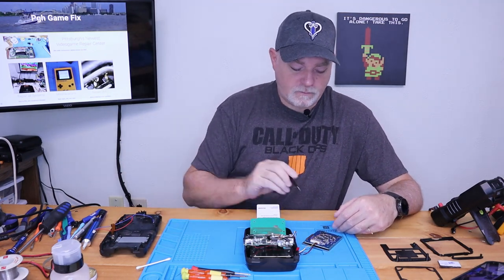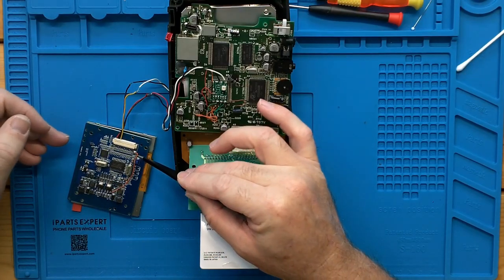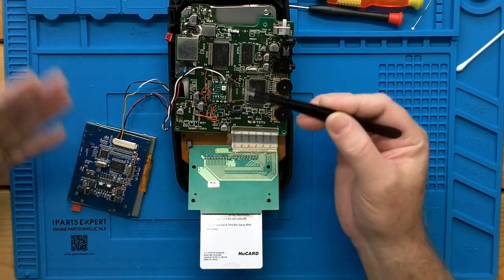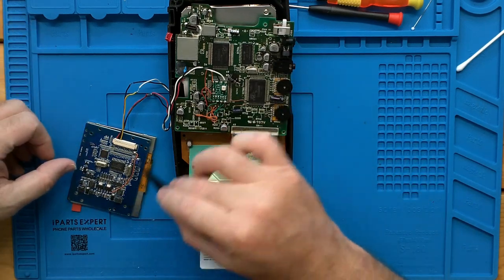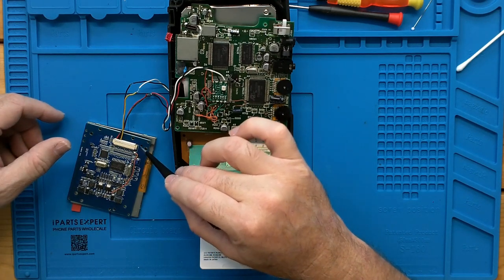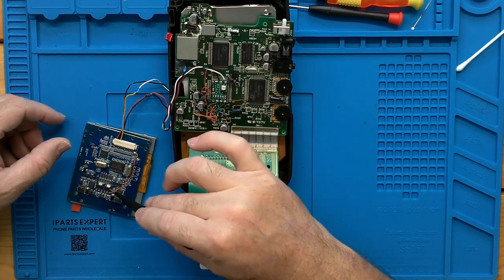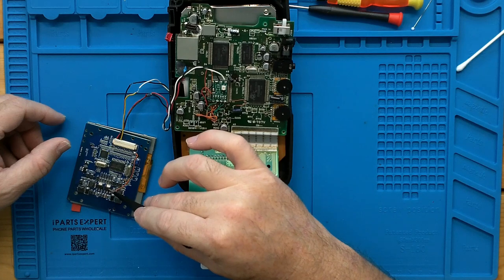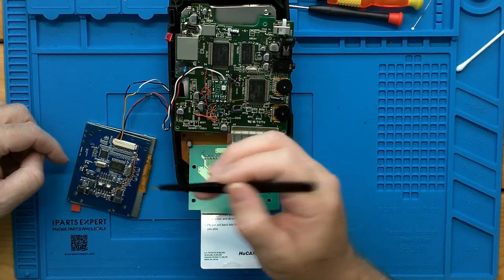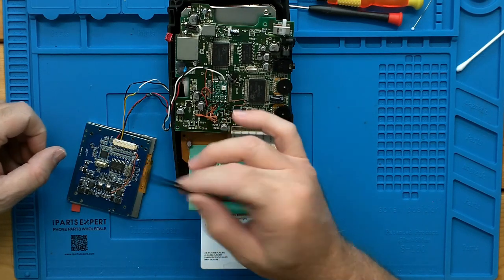So what we wound up doing is we removed the first diode in line because we're not going to accidentally plug this in backwards. And that saves us about 3/4 to a 1 volt drop across that diode. Then we directly wired to our 3 volt regulator. This is the only regulator we need on this entire board since we're only using the one input. This modification is actually shown on Console 5's website.